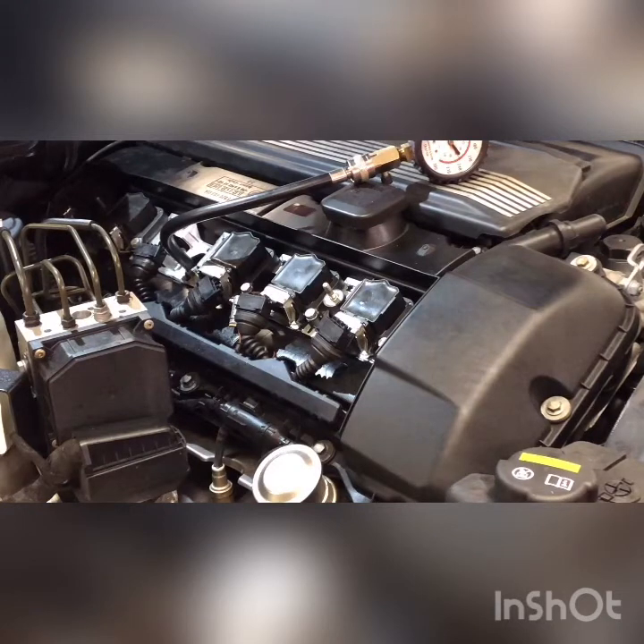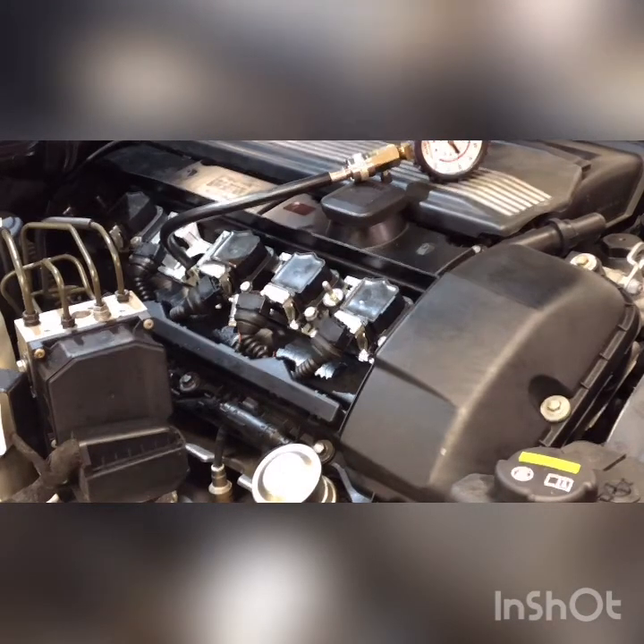What I'm going to do now is maybe do a cylinder leak down test to find out what the problem is — probably a valve or something. I'm not getting coolant in the oil, so I know it's not a head gasket. I'm thinking either running it a while with some additive in the tank, or doing a leak down test to see if it's an exhaust or intake valve issue. If so, you're going to end up pulling the head.